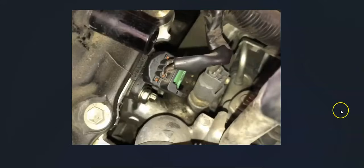If the wiring all looks good and there are no issues there, then it's likely time to swap out cam sensor A. The sensors themselves are usually pretty easy to swap out, but the location can be difficult depending on the Nissan. Sometimes they'll be directly on top of the engine, easy to access. Other times they'll be off to the side, like behind the firewall. Pulling the sensor out is pretty simple — it usually just has a 10 millimeter bolt and a wiring harness that you pop off. Put the new one in, put the bolt back in, and reattach the wiring harness.